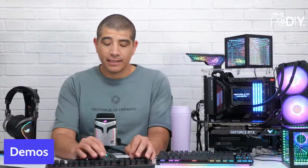But there are, of course, a lot of different benchmarks available to you that allow you to test that. One of the easy ones, an older one, depending on games that you may or may not have in your library, if you want to try things out, you can always go to different sites to download files. You've got Gravity Mark, which is a free GPU benchmark. You've got Basemark. There's a Final Fantasy Endwalker benchmark, which is openly available. There's, of course, Unigine, which also has availability. There's also Resident Evil. There's a Sniper benchmark. There are a few different benchmarks that are available as a downloadable exe. And then, of course, if you've got games, there are tons of benchmarks in different games, everything from Batman to Forza to Metro, that all have their own benchmarks built in that you can run.